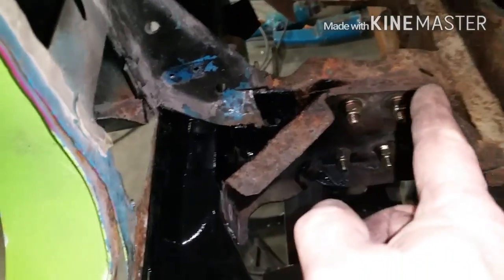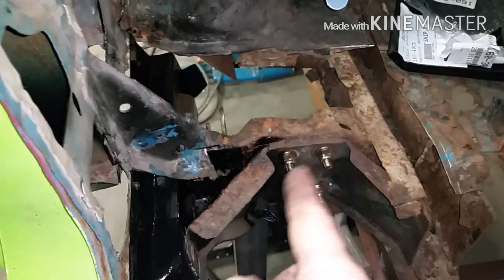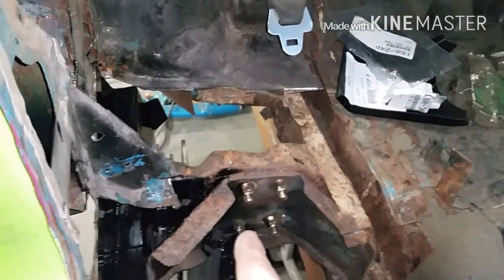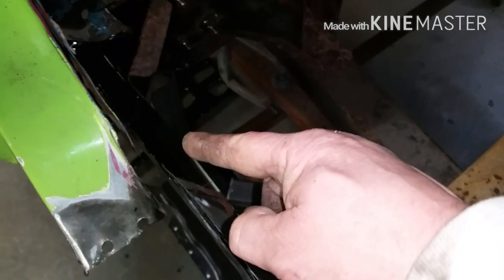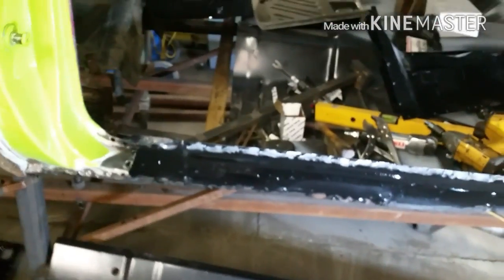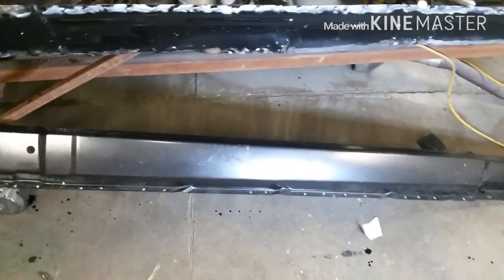That's going to be my saving grace there. That's the subframe that connects it from the outer rocker to the inner subframe. So obviously I couldn't take that off with this off as well, then there would be nothing holding this anymore. So now that I've got this attached to the inner rocker structure, which is fine, it's still not rigid enough. Once I put the outer rocker on, that becomes a giant tube connecting front to back. Starts to make sense once you start doing it. You've got a section right here where the cross member attaches. So all in all, it's like a frame, a subframe.